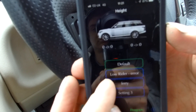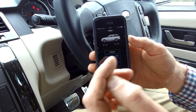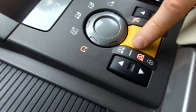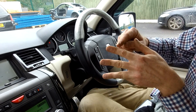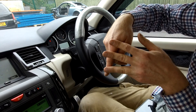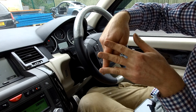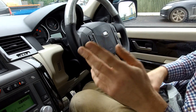Basically, on the car if you look at the suspension settings, we've got the low position which we're currently in, the access position, the normal height, and the off-road position - three settings. Whatever you adjust on this IID tool, if you want to make the normal cruising height lower, it will shift all three heights down by that amount. If you make it higher, all three go higher. It basically recalibrates the suspension across all positions.